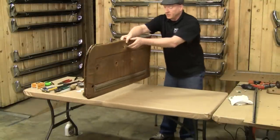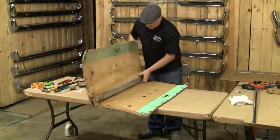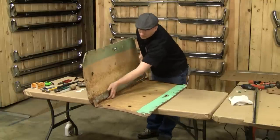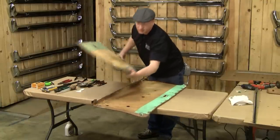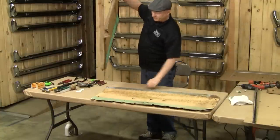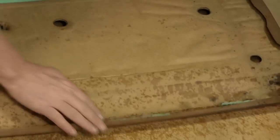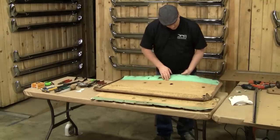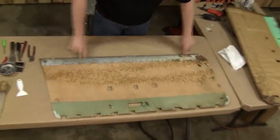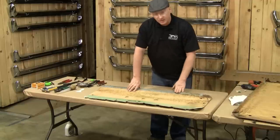Back to the panel — I'm going to turn this around so you can see what's going on, and essentially we're going to peel the panel out. What you see here is the door panel and the separated vinyl. The vinyl on this is in pretty good shape — you can see there's a paper backing, it's been lightly sprayed with contact glue from the factory. It comes down and stops at this point, and then there's a foam fabric. The next step will be to remove this from this — you can see the holes here and some rust on it; we're going to clean that up.